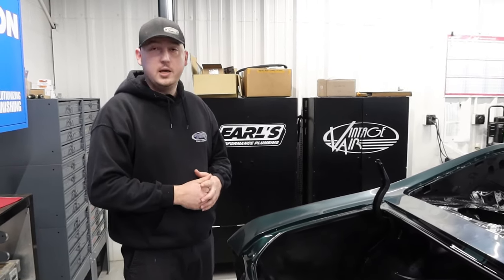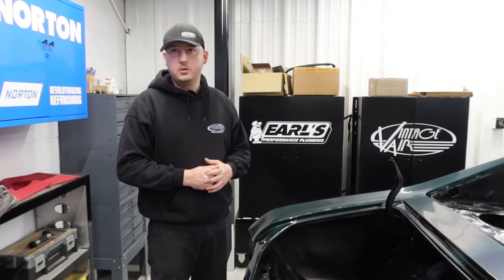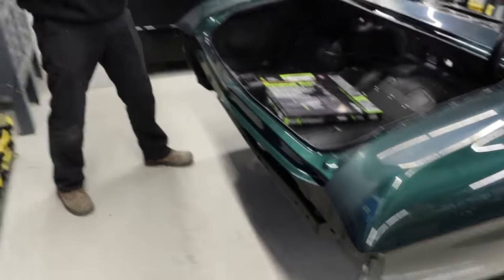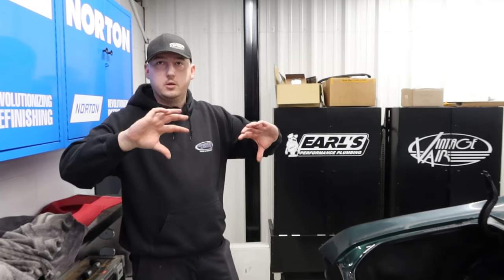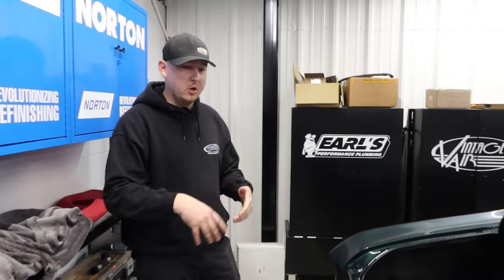And this is 3-inch exhaust getting on this? Yeah, full custom 3-inch exhaust, Hooker mufflers. Where's the exhaust dumping — is it going to come straight out the back or do dumps? The exhaust will be our typical exit point. It'll stop just before the rear bumper with a nice little turndown. From the back of the car you won't really see it much unless you stand way back. It'll be kind of tucked up and hidden, but it'll still completely exit the body because you don't want to trap all that noise and fumes underneath the chassis. It'll just have a little bit of a turndown, nothing special.